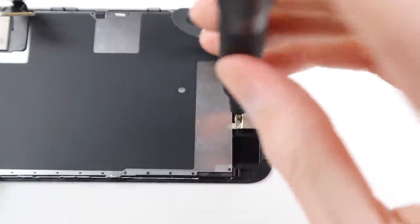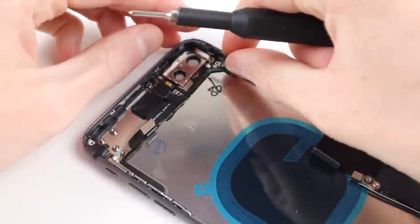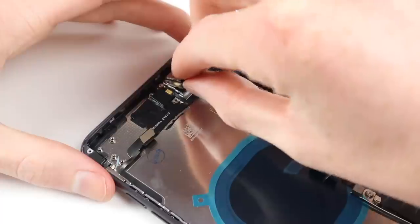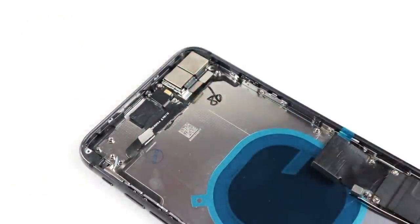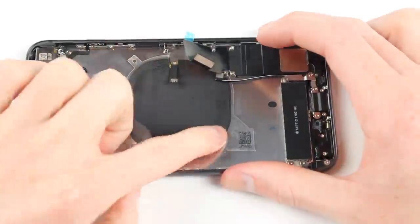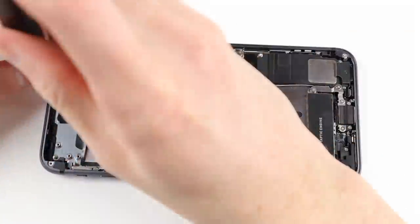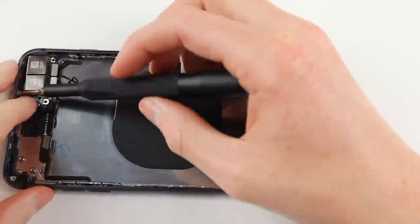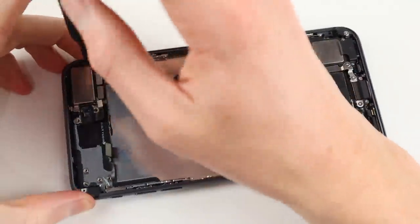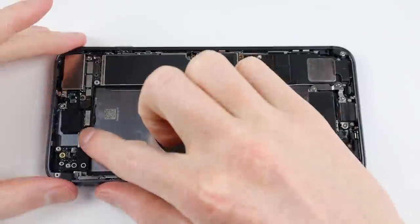I can move across the earpiece and front camera, and the new display is prepped and ready to go. I can install a new antenna up the top here which was previously broken on the old housing after it became snapped up the top. I can install the dual cameras and a new wireless charging coil as I damaged the old one in the removal process. I highly recommend buying a new wireless charging coil if you do a housing swap on an 8 or 8 Plus because they are extremely fragile and you're almost guaranteed to break it in the removal process. And finally it's time to reinstall the logic board back into the iPhone frame, and things are now starting to look like a phone again.